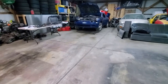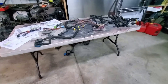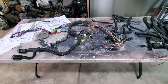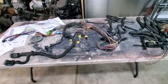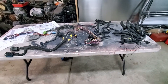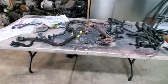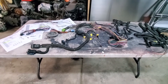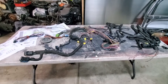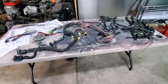We're going to clean the parts area up, organize all of our spares, and I'm going to jump back into my wiring harnesses. I've been thinking about how I was going to finish this particular harness off, because it's currently a manual transmission with stock instrument cluster and BCM support. I have a lot of guys that want harnesses, and I was thinking whether to make a manual or automatic transmission harness, or one without stock cluster support, because everyone wanted something different. I think I'm just going to make the harnesses with everything — leave the automatic transmission plug hooked up, leave the BCM and instrument cluster connectors.